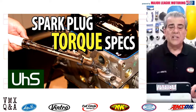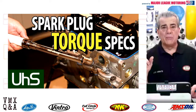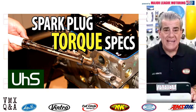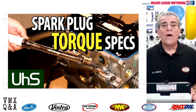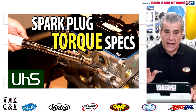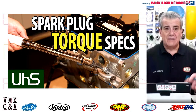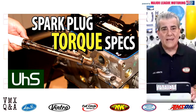Now, all of us on vintage bikes are using spark plugs that have a 14 millimeter width on the diameter of the spark plug. And what I learned is that they should be torqued from 18 to 20 foot pounds. They suggest that you do this when the bike is either just warm or cold, but not when it's hot. So yeah, whoever told you that spark plugs should be torqued is absolutely correct. I bet a lot of us aren't doing it, but it's something to consider next time you change the plug in your bike. Thanks for the question.